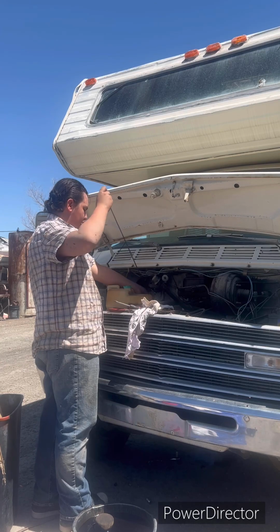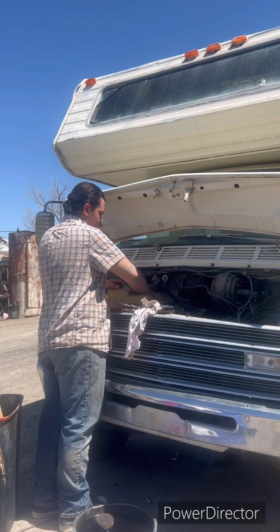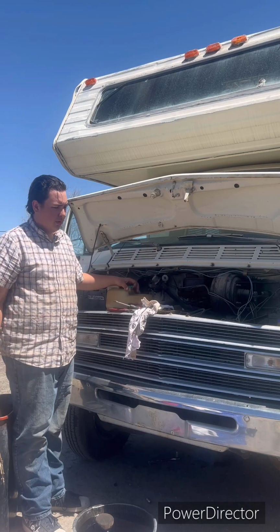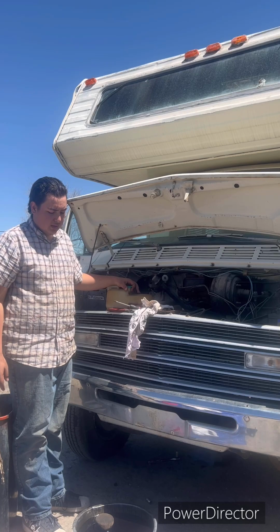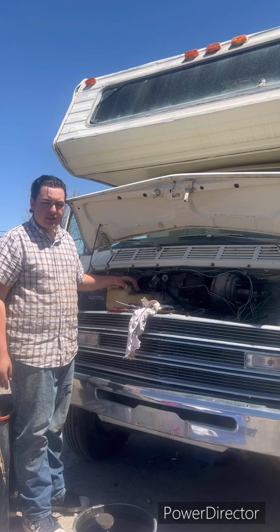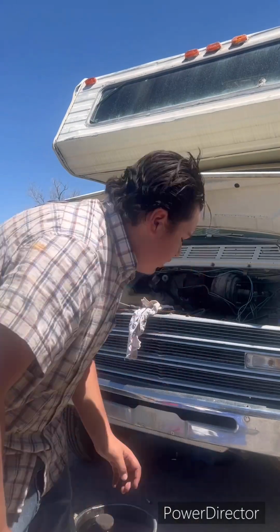is it's gonna need more, probably, is what I just remembered, because your oil filter takes at least a quart, so you want to start it up, maybe let it run for 10 seconds, get everything in that oil. 10-15 seconds. So let's do that. Let's start it up. Check for leaks. Always check for leaks because that oil filter might leak. So let's start it up.